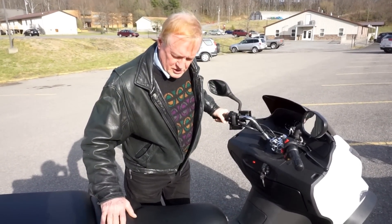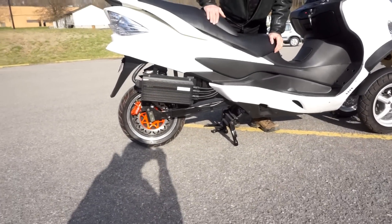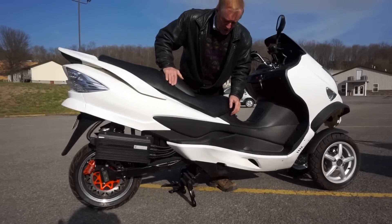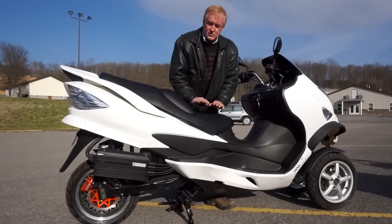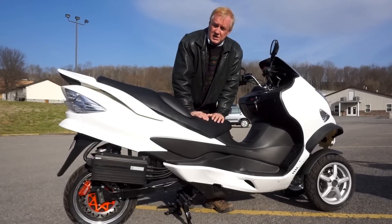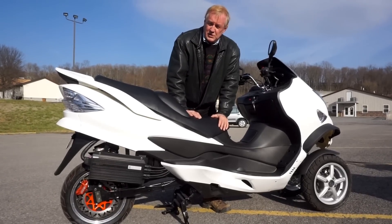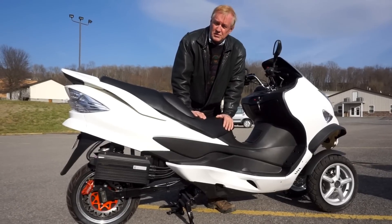The swing arm is unusual since we use hub motors and don't have to pay attention to the angles that chains make relative to the swing arm. We have this pivot point right in the middle of the bike, directly under the rider, so that when you hit a big bump and the rear suspension gets kicked up, you get more of a cushioning effect as the bike basically squats in the center and the rider gets a very smooth, non-jolting ride.